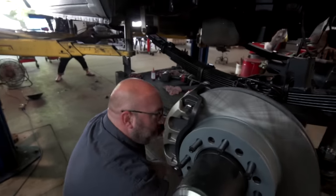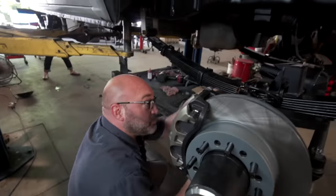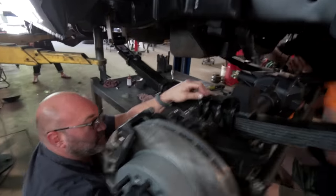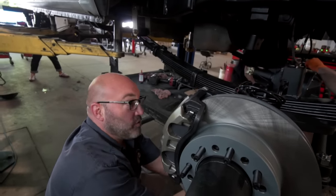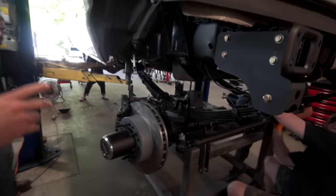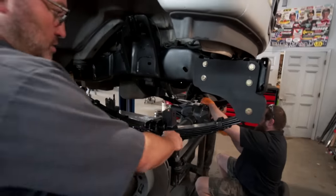How many variations do you have of this kit, from the first one you built to what this is now? Probably like twice we've changed it. We only changed these because when we switched from Bilstein to Fox, the Fox shocks have a much bigger head, so we just changed the cup size to gain a little clearance. The upper track bar mount has been through a few revisions, but these have stayed the same since we designed it a year ago.